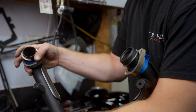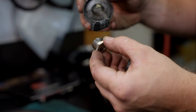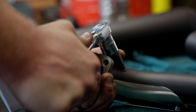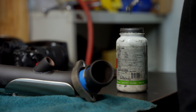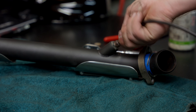This is going to remove the O2 bung plugs. This bike happened to have narrow band O2s. The kit comes with a reducer — apply a small amount of anti-seize to the threads. Screw that in and tighten them down front and rear, and that will accept your narrow band O2 sensors. It will plug back into the original ports underneath the seat. Apply a little bit of anti-seize on the O2 and snug that down.